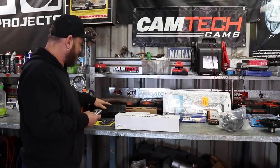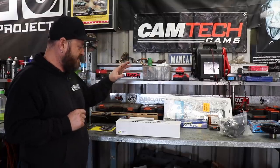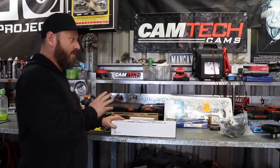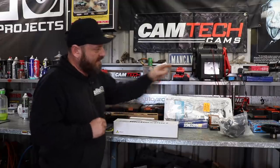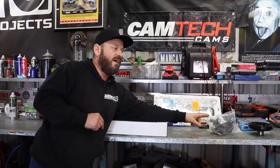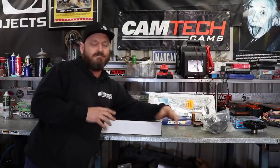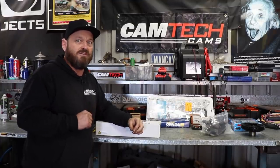There's a set of push rods and also assembly lube. Precision Motorsport — also Australian — supplied a whole bunch of stuff via Ian, including a timing chain set and a new oil pump. It's just a standard oil pump. It is not recommended to use high volume pumps on Holden V8s because they are driven off the camshaft via a gear, and high volume pumps tend to kill the camshaft and/or gear and then kill the whole motor when it stops turning. So a brand new standard pump is actually a pretty good thing and that's all you really need.